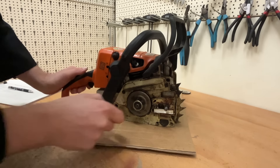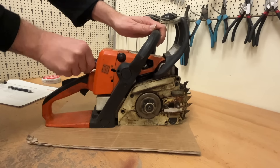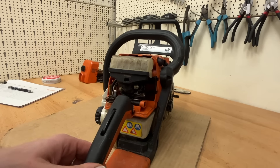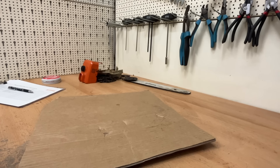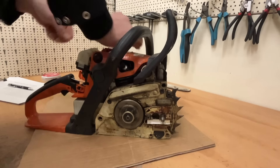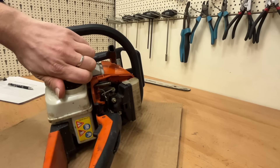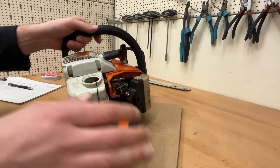I hope this device doesn't have a seized piston, because then I'd be showing you for the fifth time what a seized piston looks like. First, the incoming inspection: I'll remove the sprocket cover. The bar and blade were already dismounted, which makes assembly easier. You can see the sprocket is really heavily worn — I'll show you that later. Then the cover comes off and we check the air filter, which is normally dirty. Then I pull the saw through to check the compression — it seems to be there. There's really solid resistance.